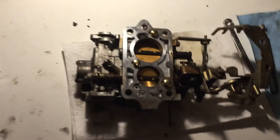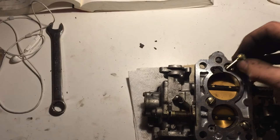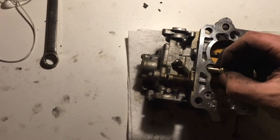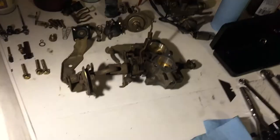I used a number two flat head screwdriver to remove the three screws holding the flange to the body of the carburetor. There's gonna be washers under each — pick those up and don't lose them. I'm gonna have to get some sort of smacking device and separate this flange from the carburetor body. Well, the moral of that story is you need a bigger hammer.